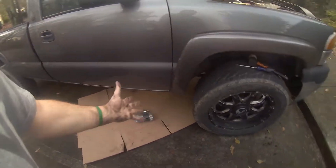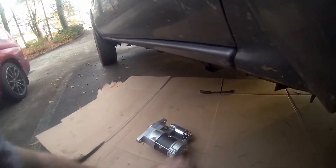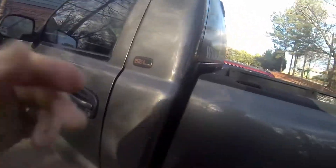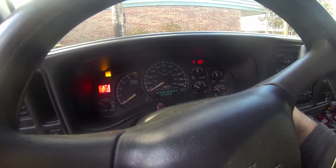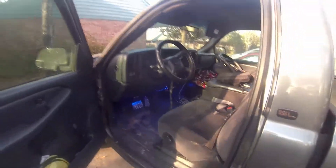Let's get the new one back in. Flip it over so the solenoid is on the bottom, then it kind of just sneaks up through here, and then flip it back over. Be ready with a rag to wipe off any oil or grime you get on your contacts. Alright — moment of truth. It's all back together. Let's see if she'll start and crank. Everybody's happy. Bam — well, that worked out great.